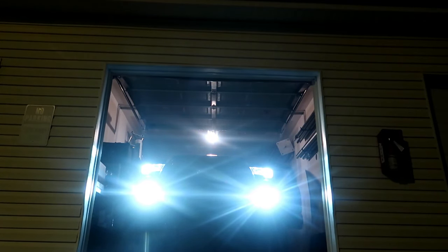I'm back and it's been a little bit — I've had the LEDs installed and been using them for about two weeks now. Let's pull the truck out and I'll show you the LEDs. As you can see behind me in that clip, they're bright. Like I said earlier, unlike HIDs, LEDs are instant on. HIDs have a little bit of a warm-up phase, and you can't actually turn them on and off really quick because they won't turn back on until they cool down. LEDs — instant on. We're heading out of my apartment complex right now, going on some street roads where it's pretty dark, and I'll show you guys how bright it is with just the headlights and then with the headlights and fog lights on.